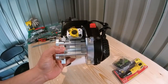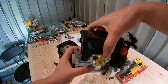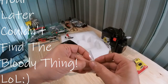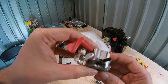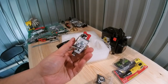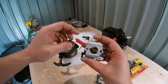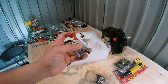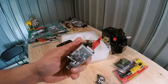I'm very very pleased with that. I need to get a finger clutch bell holder so I can stand it up. Before that - this is what comes in the kit. You get a 1191 carb - there it is. I don't have a problem with these carburetors man, it's a Walbro carburetor. The one on my Rovan 45 has been working perfectly fine, there's no leaks. So yeah I think this is going to be just fine, and I can always try different carburetors in the future. At least it's a Walbro, not an off-brand one.